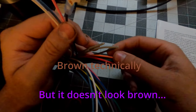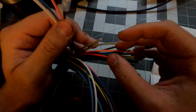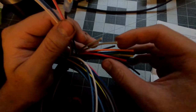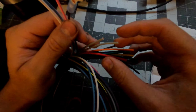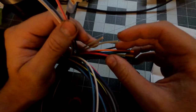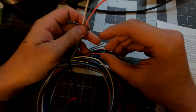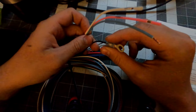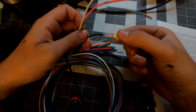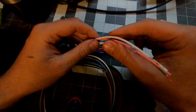Then each of these - the red, the yellow, the orange, and a dark gray-ish color - are all your 20-amp cables. These are single cables rated at 20 amps and are for your smaller accessories. These four cables include your black ground wire, which is going to be hooked up directly to the battery negative terminal and was already pre-crimped by Switch Pros before shipping.